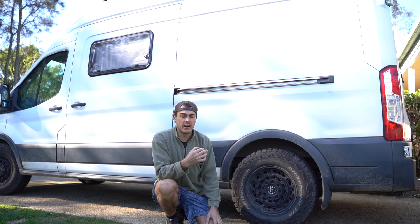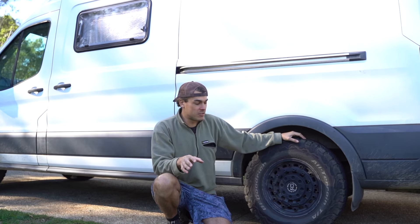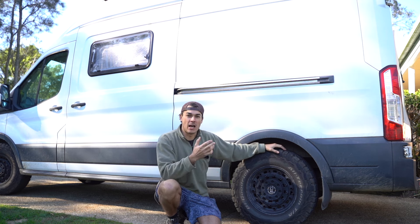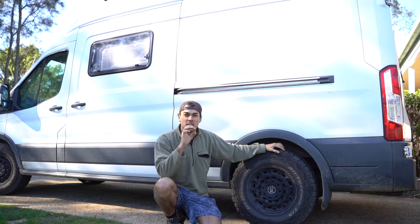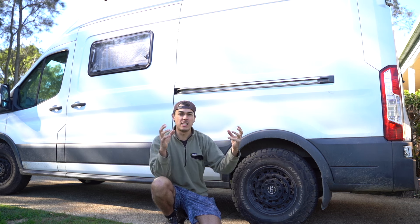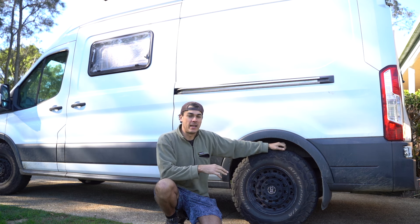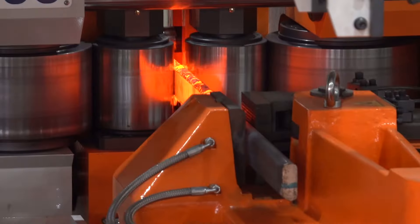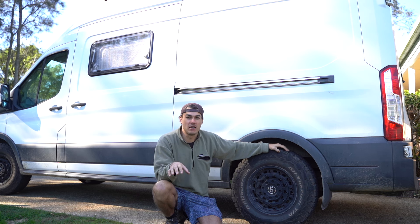I really wanted to try and fix this myself, but found it incredibly hard to find a suitable solution. The first thing I need to do is upgrade the parabolic leaf spring suspension to reduce that sag in the back and bring the height back up. Problem is, you cannot upgrade parabolic suspension — they're completely different to stacked leaf suspensions where you can add more leafs. With parabolic suspension it's tapered at each end, so you can't add additional leafs. Ford also does not offer a factory upgrade. One way is to take it to a suspension manufacturer who will custom build a new parabolic suspension, but that is quite expensive — upwards of a couple of thousand dollars.